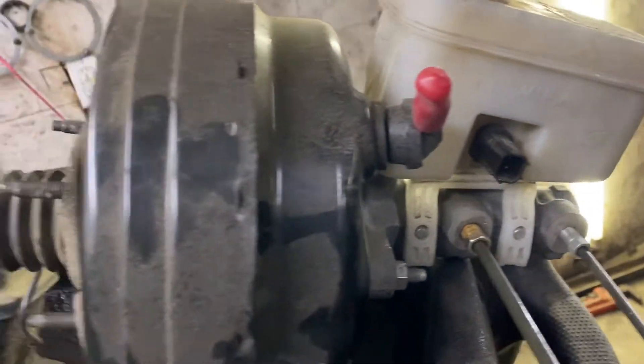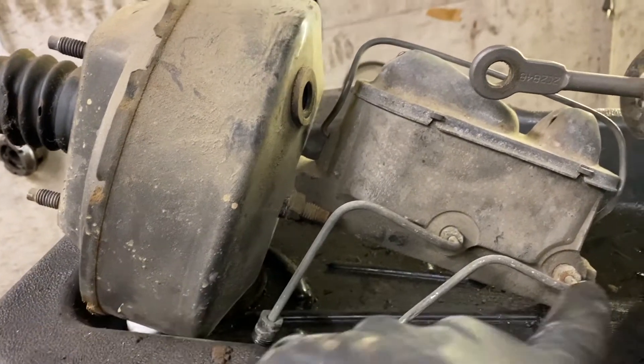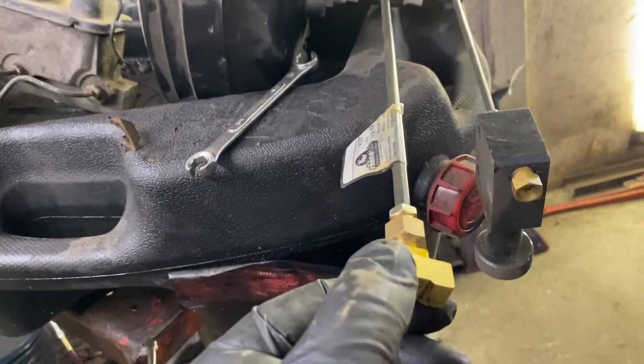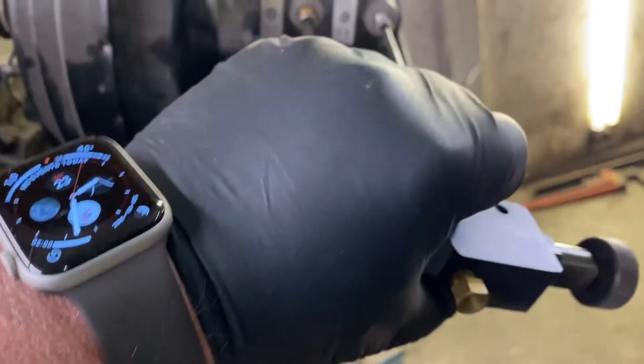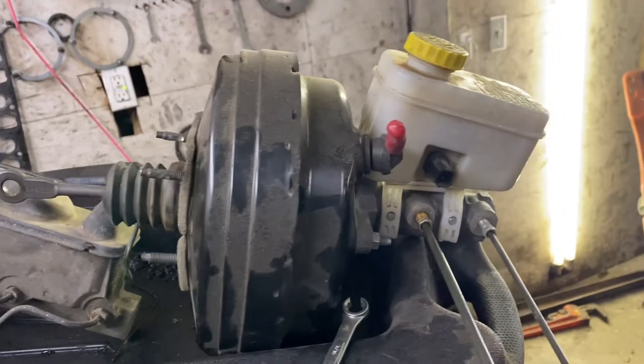So I've kind of come up with this plan. On the old 92, this is your front line and this is the rear — it's kind of strange how it lays out. It's kind of the same deal: here's the front, it's going to come out here to a T. And then here's the rear that's going to get the proportioning valve, which is fully adjustable. Most of the people I've talked to have pretty much set them up one way and leave it.